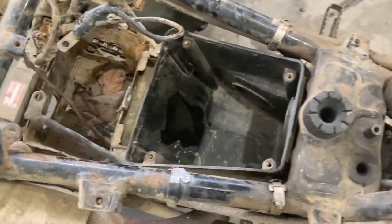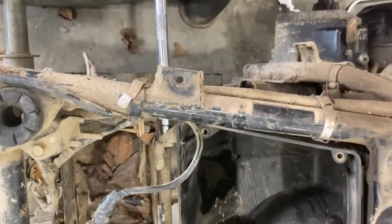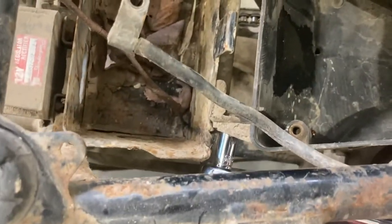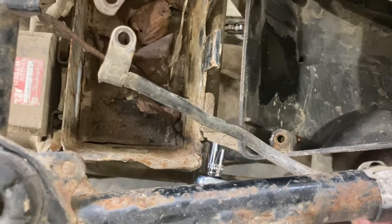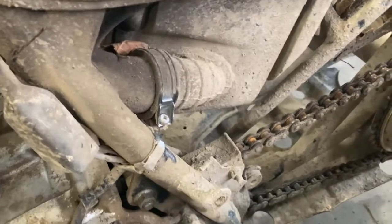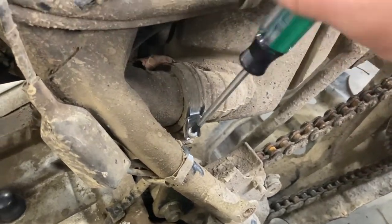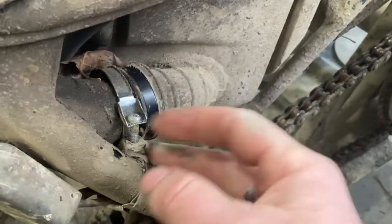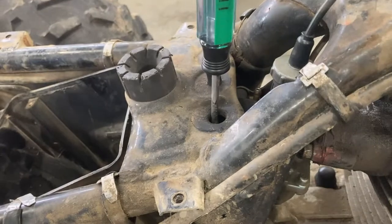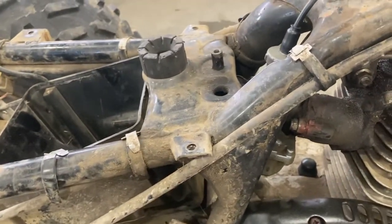Pull the old air filter out and take the rear mounting bolts off. On this side you might find it easier to use a quarter inch drive if the exhaust is still on. Took a little wire brush and cleaned that off — obviously it's pretty dirty. Loosening up the clamp for the boot, then reaching on the left hand side, disconnecting the boot from the air box, and now loosening the boot at the carburetor.